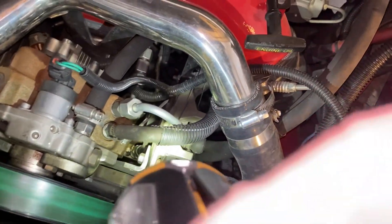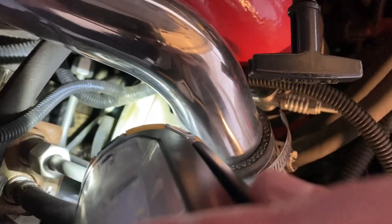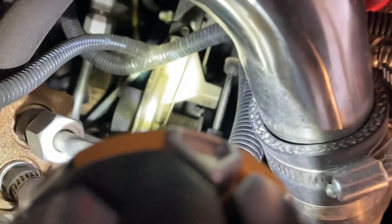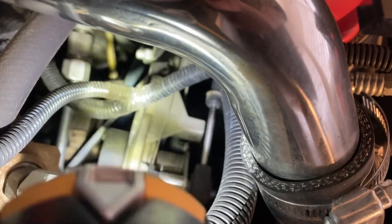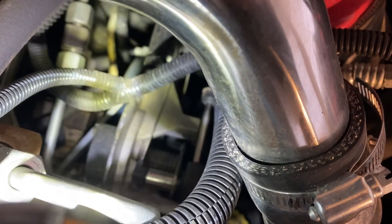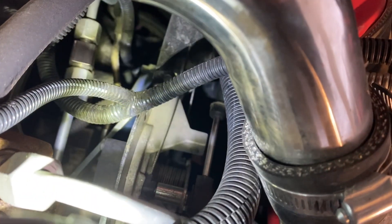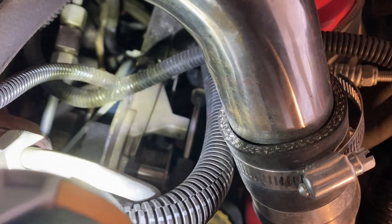One modification I had to make: looking at the second CP3, there's a support bar that comes with the kit going across diagonally at the bottom. That blue hose underneath the bar is the fuel supply coming up from the FASS to the factory CP3 below. That support bar was impinging on that fuel line in a way that you really could not assemble it — if forced, it would rub a hole in the line. What I had to do was take that support bracket and grind out an archway so it could clear the factory FASS supply line going to the factory CP3.